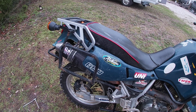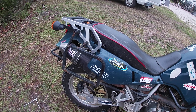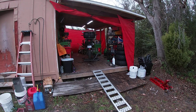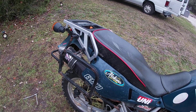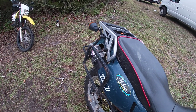It just seemed like it was running a little hot, like it was a little choked up, so I put a bigger jet in there — a 155. I'm working on other KLRs now. Everybody loves the way this bike runs and they want me to do that to theirs. So we're going to put the baffle in it and see how it sounds with the baffle in it.